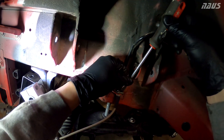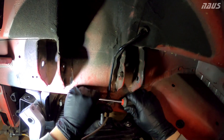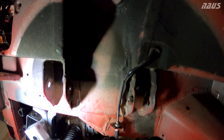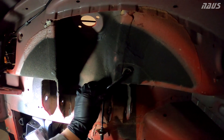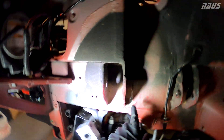One thing you're going to want to do is pop your brake lines off — take this clip off right here. Once you get the clip off, undo your brake line and pull it out. Be careful, brake fluid is going to spill. You're going to want to rotate this brake line out of the way so you can get to the inside surface and weld on each side of these brackets.